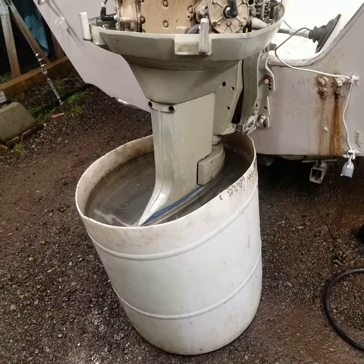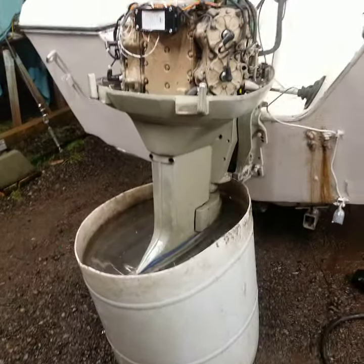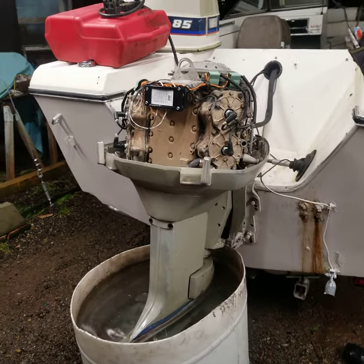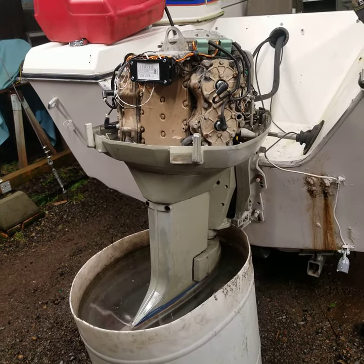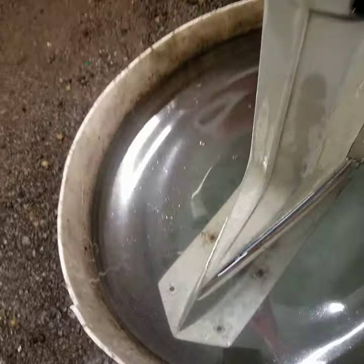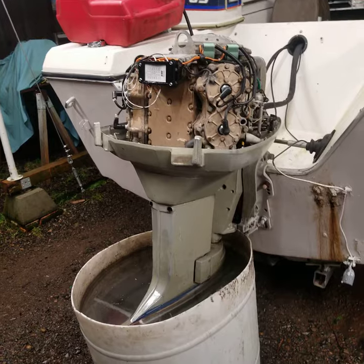The way the pickup is at the bottom, a set of flushers isn't going to give you enough pressure to cool properly, so we put it in the bucket. I'm just going to start it up for you so you can hear it run, and then I'll show you that it's cooling. I'm not going to shift it just because it doesn't have enough clearance in there — the prop will hit the bucket.